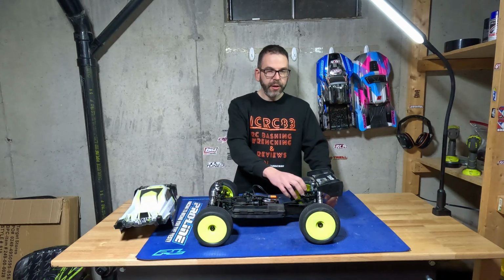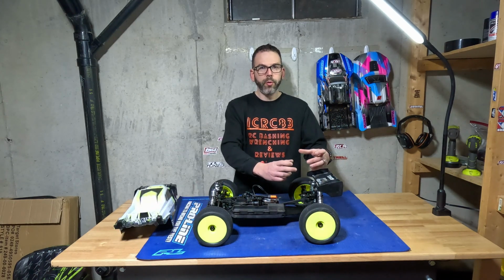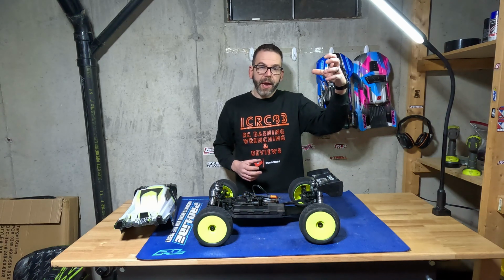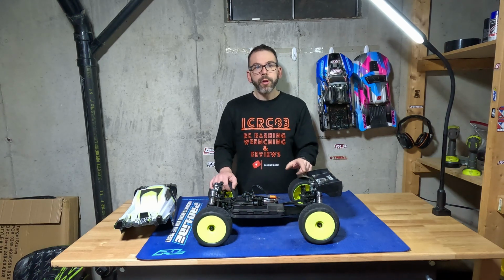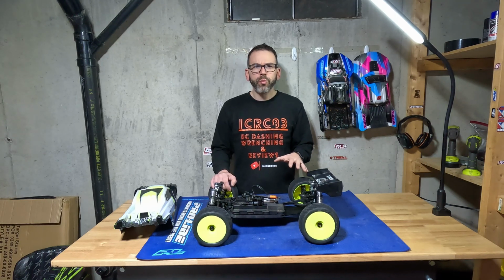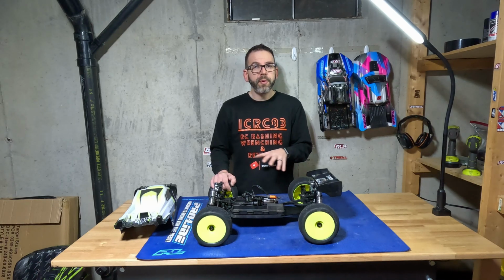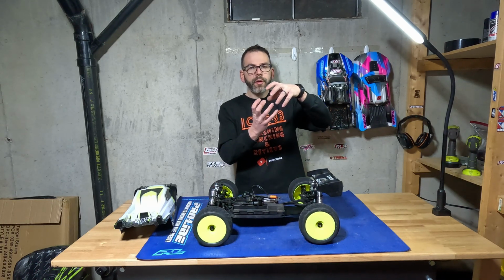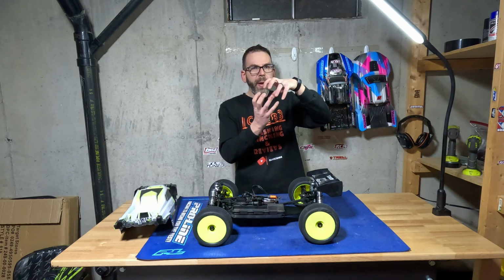It requires you to take off many parts in order to lift the top of the differential cover straight up, as opposed to many which you can take off the back half. And then once I got in it, I realized what the problem was that I was running into. The vehicle was running slow. I thought maybe the bearings were off, and then I figured maybe something was up with the diffs. Turns out the rear differential housing had dirt and grease all packed in there.